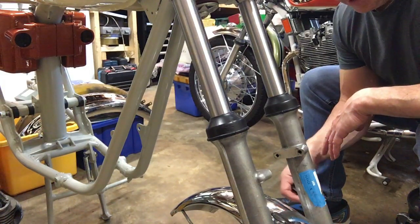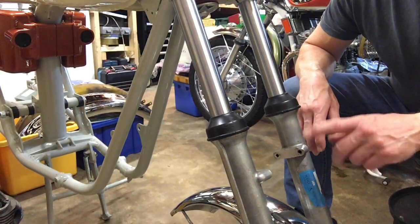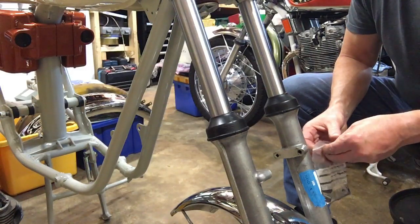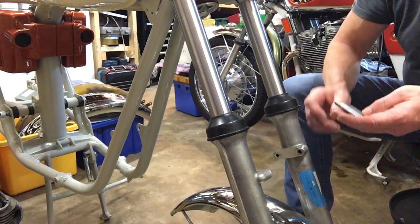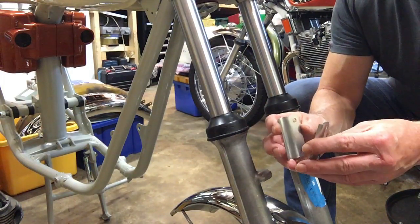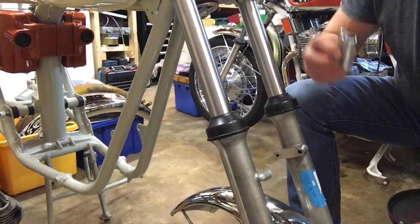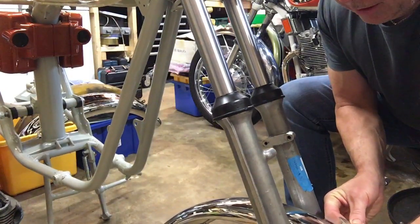So anyway, let's get down to business, firstly on the front mudguard. The front mudguard is just held on by four 1/4" UNF bolts. They secure brackets that wrap around rubbers on the mudguard stay. So what you have is a pair of almost half concave brackets that are pressed together to form a circle around the bracket on each side of the mudguard.